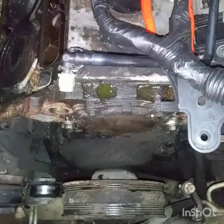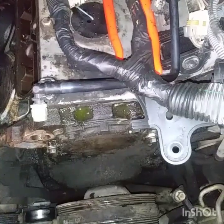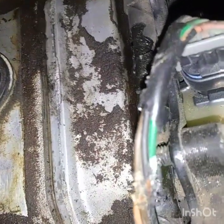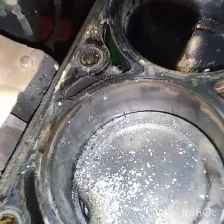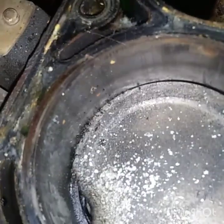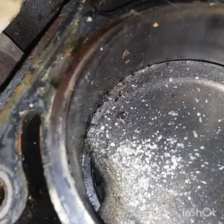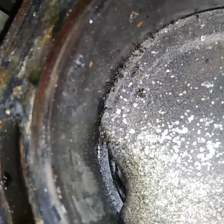They said the head gasket went out. But like I said, as I got to pulling things off, I started noticing a bunch of other little stuff that needed to be done. A couple little wiring issues that need to be taken care of now. And here goes another issue over here. As you can see in that corner right there, that piston is broke. There's a hole in that piston. And yeah, you're not seeing things. That is a hole in that piston.